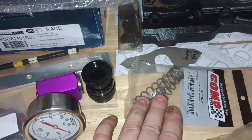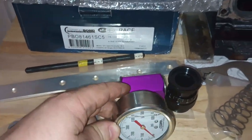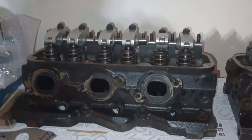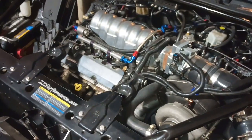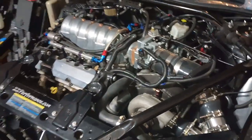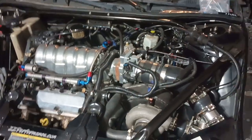We can use these test springs to mock up the geometry so we're not having to fight on and off a full-strength spring as we work through this geometry. I also want to see what kind of strength a lot of these springs are — this is my second set of used heads with aftermarket stuff on them. The ones I'm not sure about have some rust on them, which is never something you want to see on valve springs, so I probably won't test those. At some point I will want to test the ones coming off Bad Grandpa — they're like a Stage 2 equivalent; I believe they have 130-pound springs somewhere in that ballpark — but we've never known for sure, so it'll be a good excuse to test those when we get a chance.